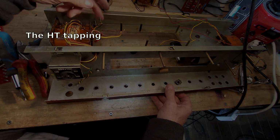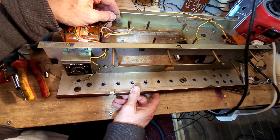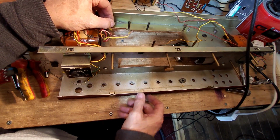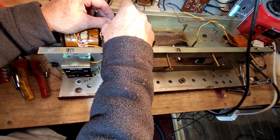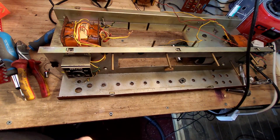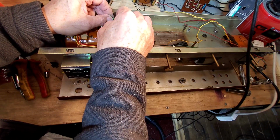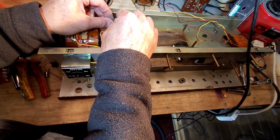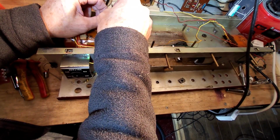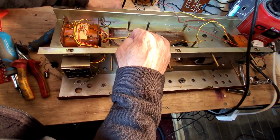You can see we've not got much wire on those, so again, you've got to be really careful. So again, we're going to have to strip these down, and I always use a Stanley knife blade for these. What I do is I work my way around them, and then you can just pull the plastic off with your fingers, and it works really well. Let's see if we've got one. So I always take one of these, always cut towards a friend, like so, and just as soon as you feel, you can tell when you've cut through and got to the actual wire inside, and then sometimes they just twist off.